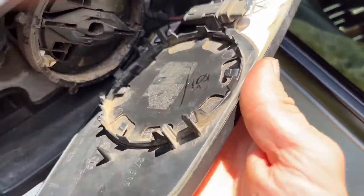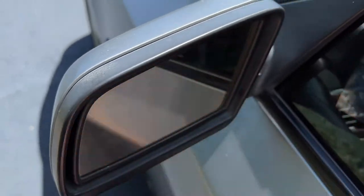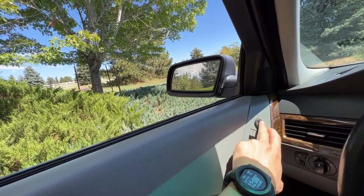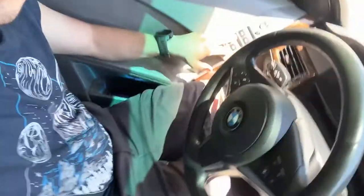So I'll plug it back in with the ribbon cable cut, line it up, and it just snaps into place. Then I get the door panel all back on looking pretty. And as you can see, the windows work. The mirror still works — you just don't have the auto-darkening and the heating, but it's not a big deal until one shows up at the junkyard and I can pay $5.99 for it. Anyway guys, I hope you found this video useful. Before you start replacing the switch cluster, definitely give that a try and disconnect the mirror. If that doesn't work on the driver's side, definitely check the passenger side as well. It also could be something else in the mirror like one of those little LED modules, because that seemed to be related as well. I'll catch you next time. Peace out.